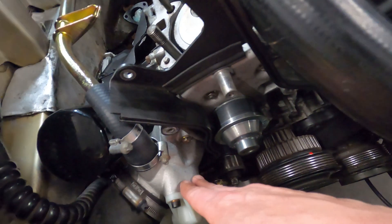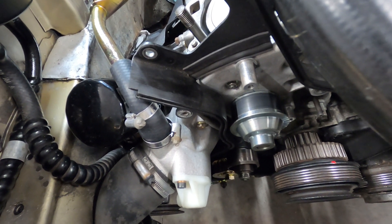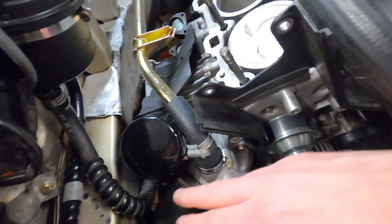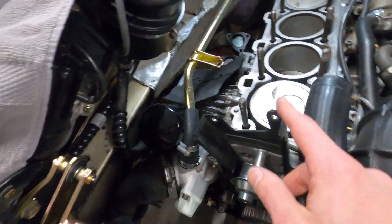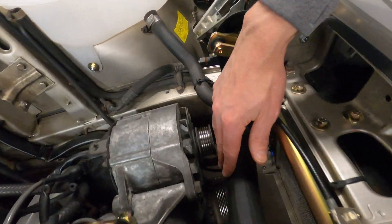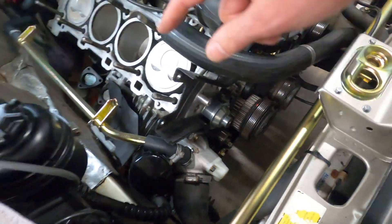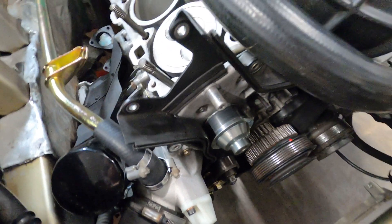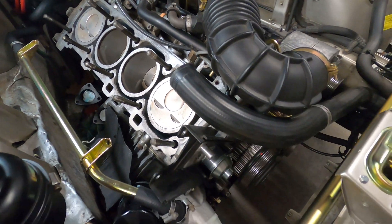Inside the water pump is a thermostat spring plate gated system that is closed until it reaches a temperature of about 80 degrees Celsius, when it begins to open, and it's fully open at 90 degrees Celsius or 194 degrees Fahrenheit. At that point, fluid can be drawn from the bottom of the radiator through the water pump, creating space in the radiator to allow coolant passing through the head to travel through the line at the top of the radiator, passing through all the fins and the electric fans to dissipate the heat. The intent of the closed system is to allow the engine to reach operating temperature more quickly upon startup so that the oil is at the appropriate temperature to properly lubricate all the moving parts of the engine.